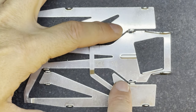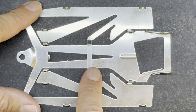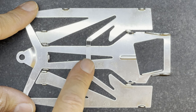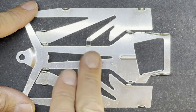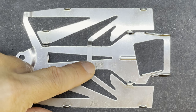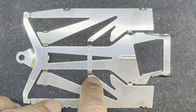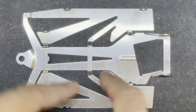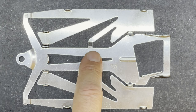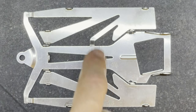As you lower that bar it will make the pans ever so slightly wider at the back, but not by very much. Why do we go to all the effort of lowering this bar? Having everything as low down as possible in the chassis just helps lower the center of gravity. I don't like seeing a massive gap here - also the larger the gap, the more chance there is of the inside of the pans falling below the center section and catching on the track in extreme cornering situations. So if this bar across the center can't drop too much, it will stop these bits here from catching on your track.